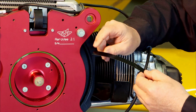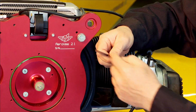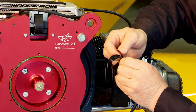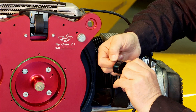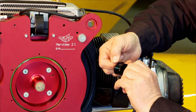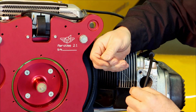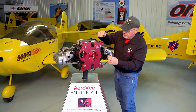It makes it a little easier to do the job if you pre-curve the shim stock. What I do is just grab the end of it, twist it around in a coil like this and kind of spring it together, give it a little springiness, hold it for a little while and release it. You'll end up with a slightly curved piece of shim stock and that'll make it a little bit easier to do your measurement of the clearance.